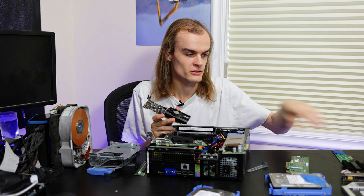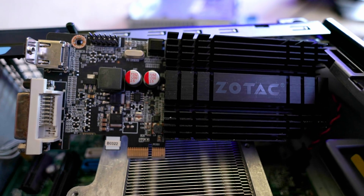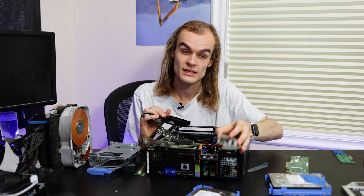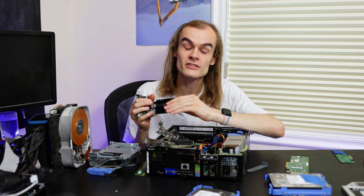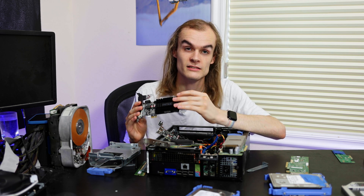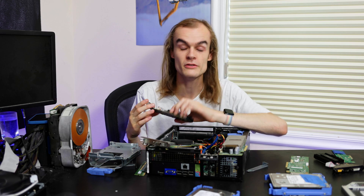For graphics cards you have a few options. One interesting option is the GT710 1x, which lets you put this card in the 1x slot on the bottom and then put something else like an x4 or x8 card in the top slot. For example, you could have a GT710 which gives you better-than-onboard graphics and then also put in a 10-gigabit NIC or high-speed PCIe SSD - that could be really nice for a server setup. The GT710 also has on-board hardware decoders that a lot of other low-end graphics cards don't have.